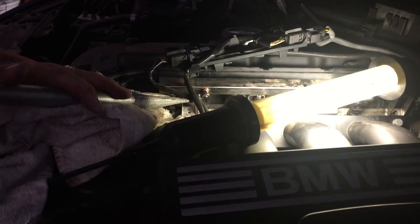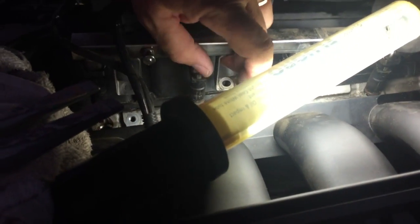Okay, so we're just trying to lever this out. I've loosened all the wires up as much as I can. Now, this is a bit crass. I'm using a ball joint puller, but this here is just the plastic intake manifold. I don't want to lever off that, but because all of these six injectors are all in there with rubber, it's a bit tight, so I'm actually levering off the top of the oil filter here. Some rags on there so we don't damage anything. Putting it under and then lifting. Whoop, there we go. And we're out.